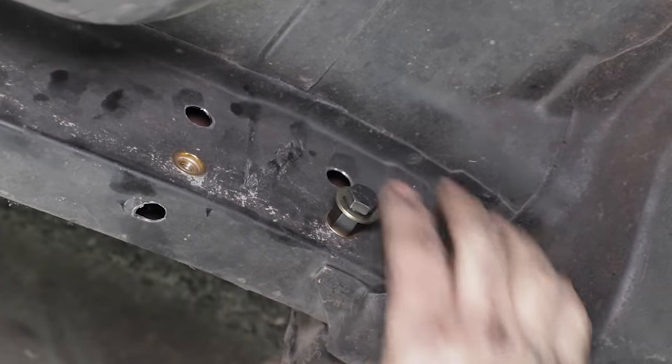The upper mounts are placed into the new crossmember. After we clean up the U-bolt length, we can locate the upper arm mounts on the rear end housing. There are detailed instructions with the kit that show exactly how to make sure your rear end is located properly. Then you just have to weld on the brackets and bolt the upper arms in place.